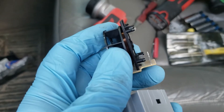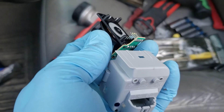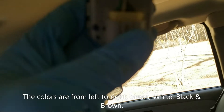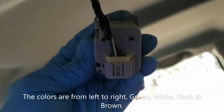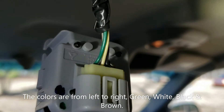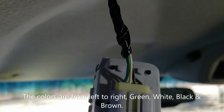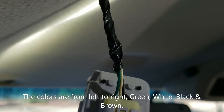Those pegs fit in holes in the back of the sensor housing. They could have backed off a little bit and been caught between that and the dust, causing a vibration that sounded like a knocking when there really wasn't. I wanted to give a good view of the wires. There's a green, white, brown, and black wire — those are the wires that go to this sensor. We'll talk about where they connect in just a minute.